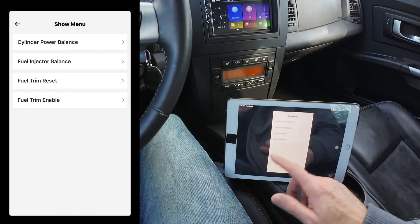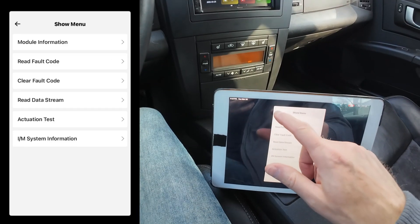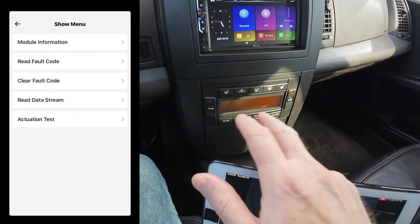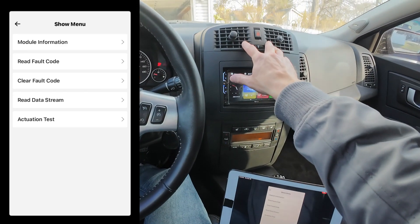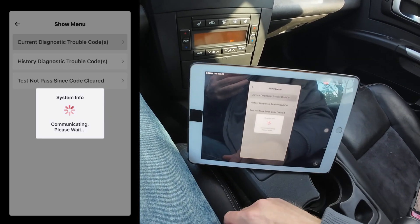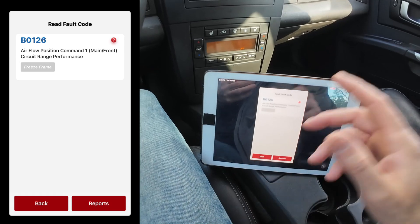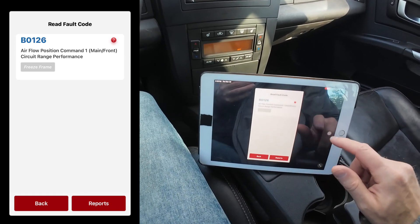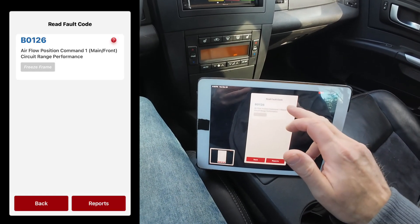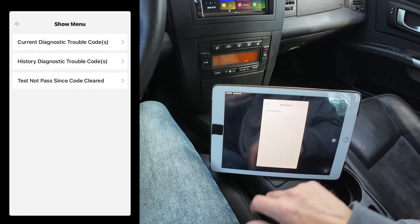Let me show you what a fault code looks like and how it can save you quite a bit of money. Climate control — months ago I realized I have a problem with the diverter; air is only coming out of these vents and nowhere else. So we read the fault code — it loads rather quickly. B means body, so you may be familiar with P for powertrain. B0126. You can take a report, you get an explanation of what this means, or simply take a picture right from your device. Press the question mark and it does a web search. Absolutely a massive time saver.